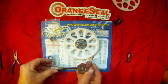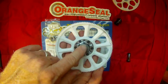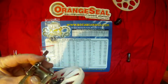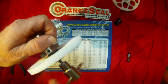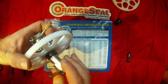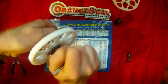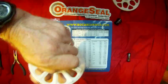I've taken my bearing press apart. On a 550, you have a one-way bearing and also a standard traditional bearing that sits on top. You want to press out that traditional bearing first. Take this part of your bearing press, put it on the bottom, and start screwing it together. It's real important to make sure you get the bearing press lined up right on the center of that bearing as you get it started — otherwise you're going to hit the sides and it won't come out well. Once you've got that lined up, crank it down. The first time you do this it might be real tight — give it about eight or ten turns and that bearing on top is going to pop out.